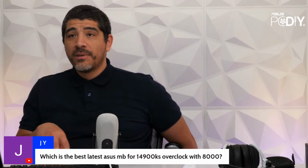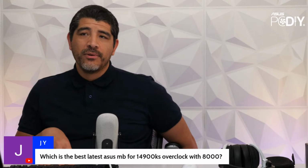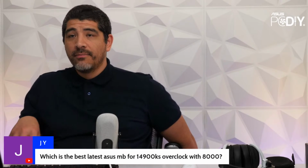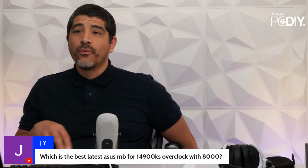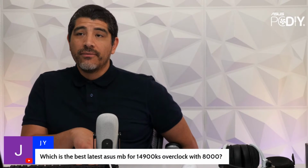So unless you're going to spend the money or you have a pre-vetted CPU that you know has already been verified to run 8000 MT, don't make the assumption, regardless of the motherboard and the memory that you buy, that you're going to hit 8000 MT. Statistically, you will not hit it. It's going to be almost a rarity for you to achieve that with a high level of stability or guarantee.